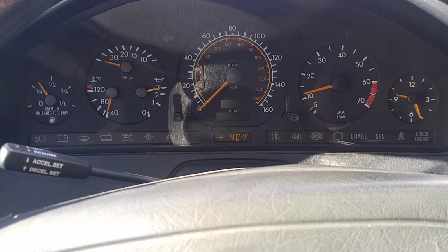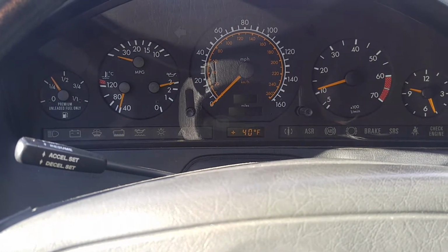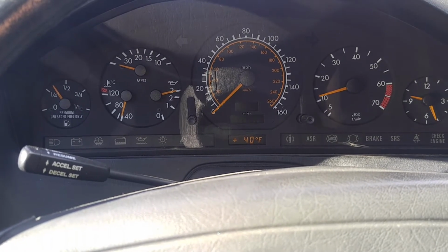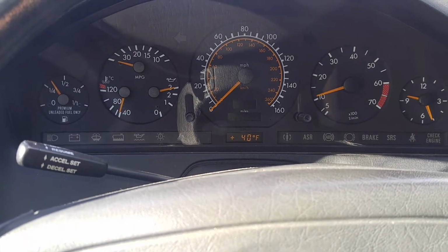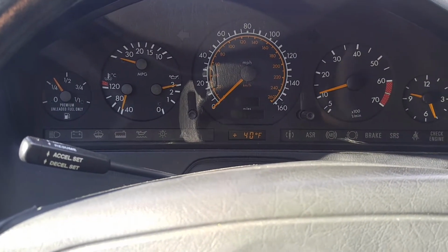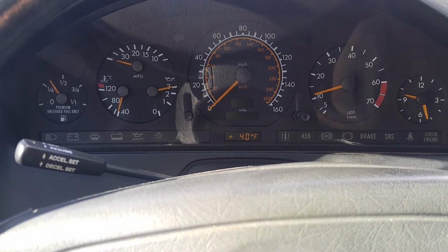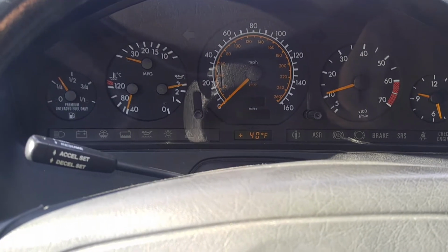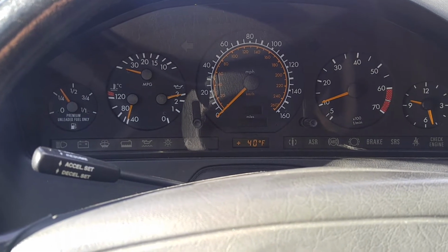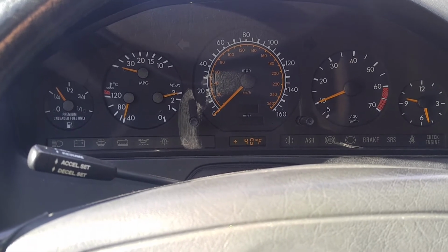It tries to catch its idle, but there could be some vacuum leaks here and there, but as you can see, the car started right up. It takes a while. It could be the breather pipe or something, not really critical. Or it could be that the post start enrichment circuit is a little twitchy, but again, this isn't principal. You see the idle is stabilizing pretty well.